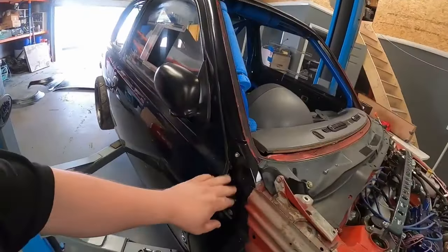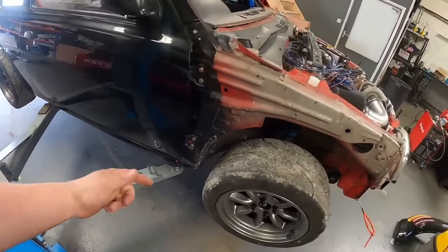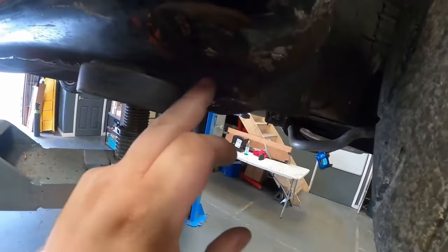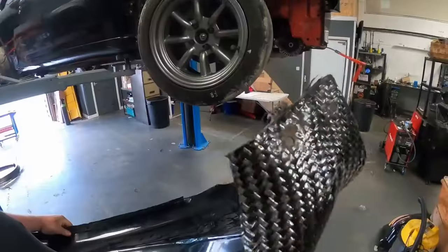Part of the process is that we haven't used complex three-piece moulds, so we haven't retained all the factory mounting points — a lot of these panels are going to fit differently to a road car. With the wings, I've already started fitting one to the car. I've put a rivnut in the A-pillar to secure it there, another rivnut in the bottom of the sill, and then we need to make some form of bracket to tie into one of the bolt holes. On this side I've put two rivnuts in there to stop the wing twisting. We've drilled two holes in the bottom of the carbon so we'll get this bolted on.